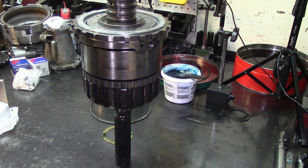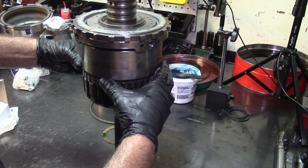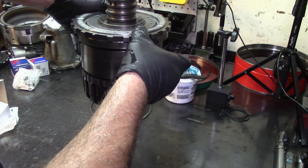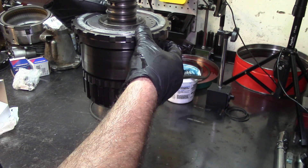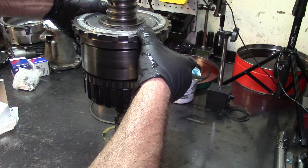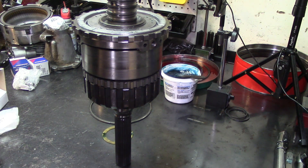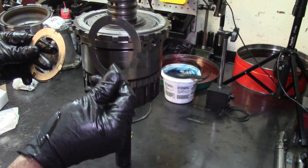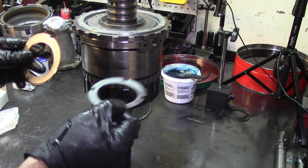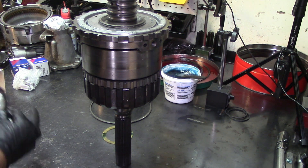I'll drop it in. When I was doing the initial assembly it had a lot of clearance between both planets. Now - I want to say maybe 5 thousandths of an inch, and I'm actually lifting it up. That's pretty good, actually real good. Let me go ahead and assemble the whole thing up to the front clearance. When you have that type of clearance, you install the shims underneath the four-tab washer and take care of that clearance. We did not end up needing to do anything for this, but the front clearance - yes, we need to take care of that.